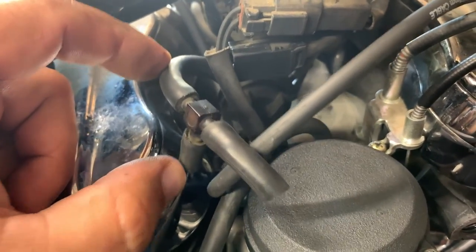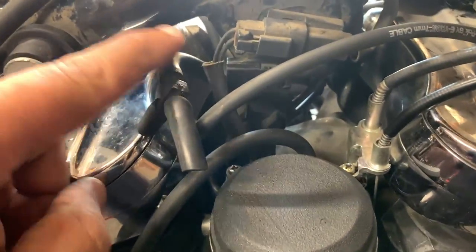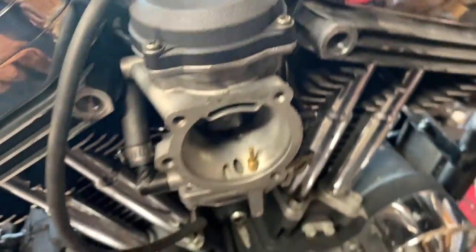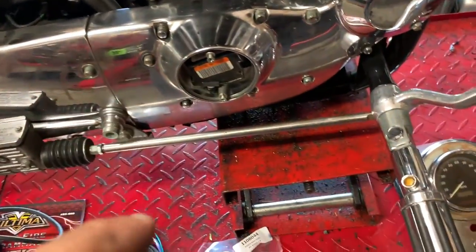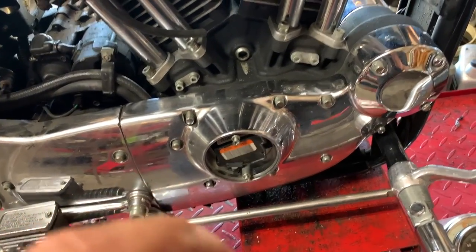Another thing I noticed is that the ignition wires that run into it have been on and off so much and looked at, tried to be fixed — they're bare. There are only like three or four wires remaining on this ignition wire, and it's a very important wire. That would be another cause as well, in addition to the VOES being unhooked — which would not give advance — and this wire being just about to say goodbye. They pressure washed the bike and then noticed after that it wouldn't run right.